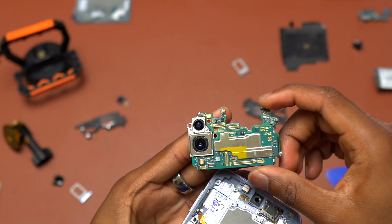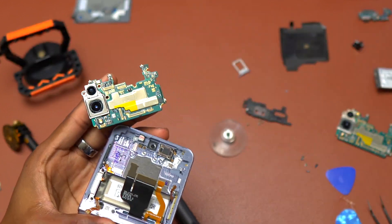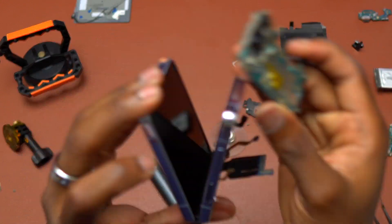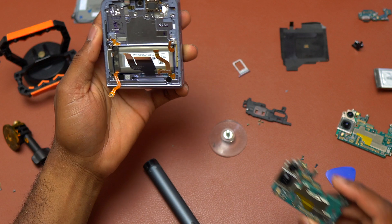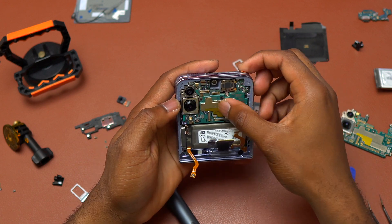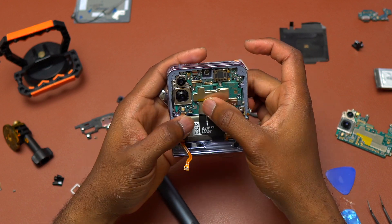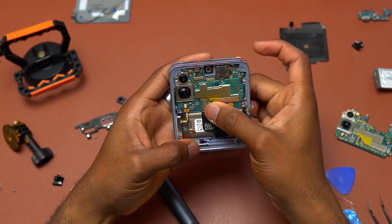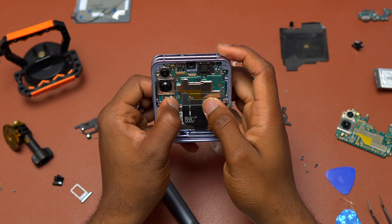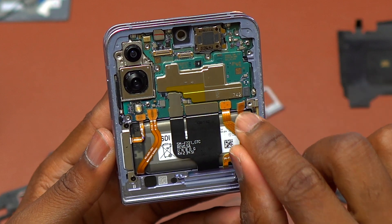For reinstallation, reinstall everything in reverse order and finish with the batteries. I'm going to insert the motherboard I removed into the device I completely disassembled — this one has a good screen that is working, which I tested. After swapping the motherboard, I should have a working Flip 4 with a new screen. The device with the new screen is the US version; the old broken screen was an international version. On this motherboard there is no flex cable port for the 5G antenna on the US version, so I will leave that open and remove the 5G antenna later if everything works correctly.